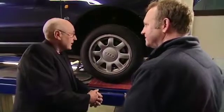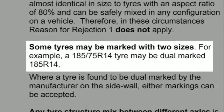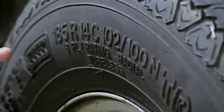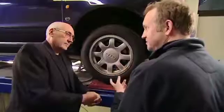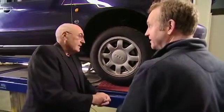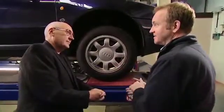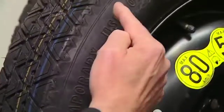You may also come across a tyre that's dual-marked. There's an example in the inspection manual that says you may have 185-75R14, and when you look on the tyre, it's also marked 185R14. So if a tyre was dual-marked like that and the tyre on the other side had either of those markings, that would be fine. But if tyres are a different size across an axle, that'd be a reason for rejection. What if a space-saver tyre is fitted? That's not allowed — it's a temporary-use spare wheel, and it's clearly marked temporary-use only, so that's a reason for rejection.